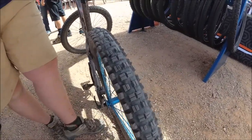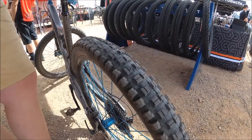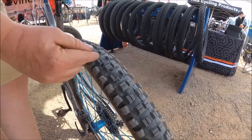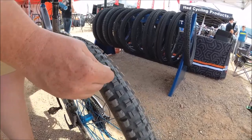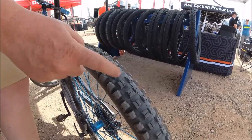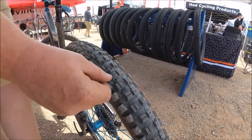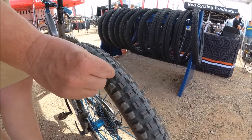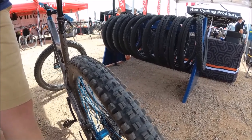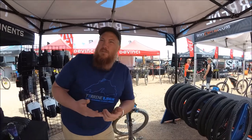Mechanical keying is essentially an edge of the tire catching on a piece of terrain — a rock, an edge of a rock, a tree root, compressing into the dirt. All of these surface areas are what's actually keying into something and allowing the tire to grab the earth and move you forward. When you add sipes — the sipes is the cut, the little line — when this tire deforms touching the ground, it's going to open up the next edge. So adding more sipes adds more potential ways for the tire to grab the ground and therefore more traction. But it can also allow that lug to deform more, and the more the lug deforms, the more drag you might have.